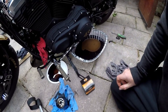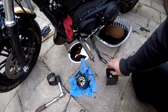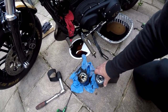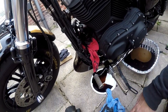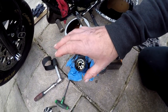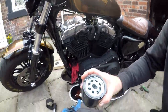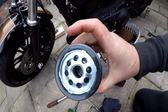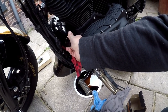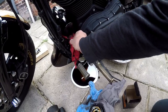So once we're happy that everything is drained out, we can clean things up and start to put things back together. Most important thing with an oil filter — never put an oil filter on dry. You want to clean off the ring around there and then just put a light smear of oil around the seal. Then it's just hand tight and a little nip. There's no actual need to use the tool to put a filter back on — just hand tight until you can't tighten it anymore, and that will do. So just a light smear of oil, you can see the shine on that. Locate it and just remember to feel the thread — make sure you don't cross-thread it. It should glide in there nice.